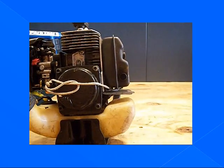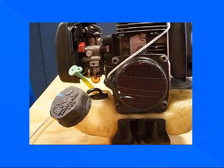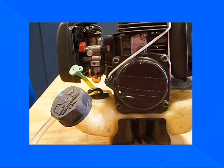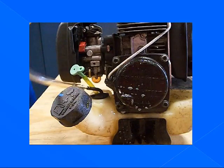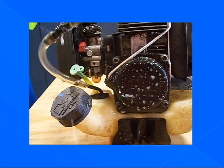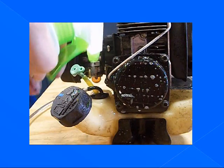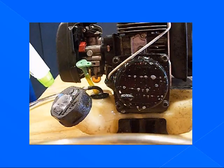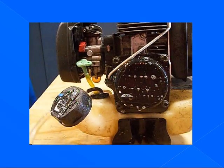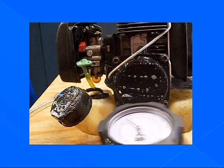Get our soapy water. Always test your test setup first — the pump, the lines, the connections. No leak there. No leak there. Do the fuel line, the grommet, the divot — everything in that one shot there. No leak there. Now the cap — and as fast as we put it in, it's coming out. Look at our leak on our cap. So we know our cap is leaking.